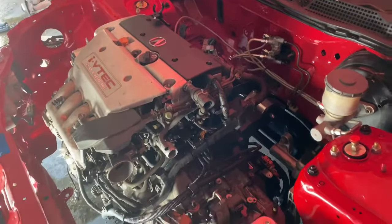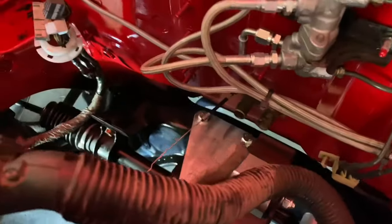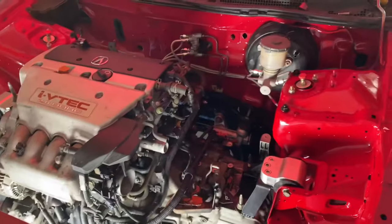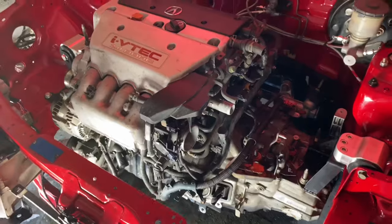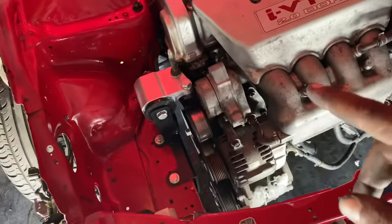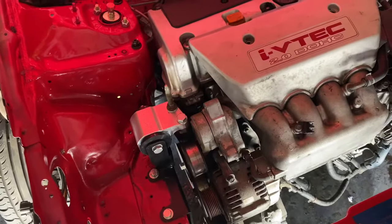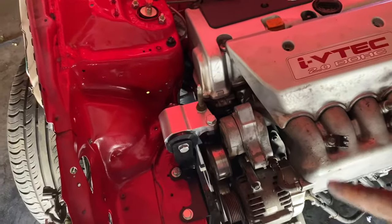I also wanted to mention I swapped out those allen bolts since they were actually for this mount and not for the rear. For the next video we're going to do the clutch master cylinder, put the ground kit on, slave cylinder, mount up the radiator, and put the EP3 pulley kit on. The belt I'll be using is off the 06-to-11 Civic Si — or an EP3 would also work — so 02-to-11 Si pulley is what I'll be using.